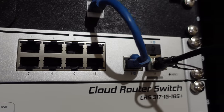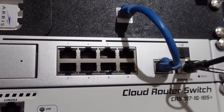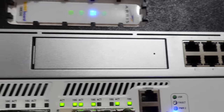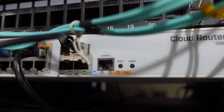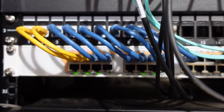At the heart of my network is the Ubiquiti UDM Pro, or Unified Dream Machine. While it is a fantastic firewall with very easy configuration and management tools, it doesn't make for the greatest core switch in the world, due to it only having one inward-facing 10 gigabit port. Until today, I've been using that 10 gigabit port as a downlink to my Microtik CRS-328-24P — a fantastic 1U 24-port PoE Plus switch with four SFP Plus ports. It is a fully managed switch, and at only $379 is a pretty good value for a home lab or small business.